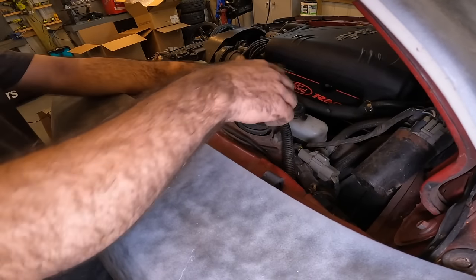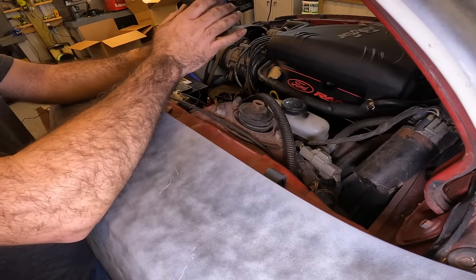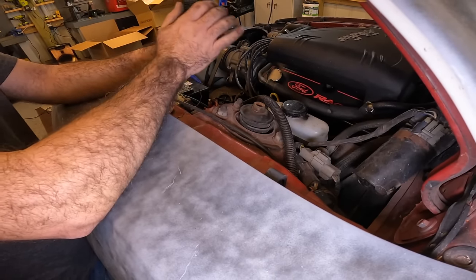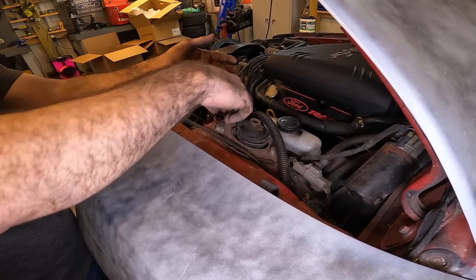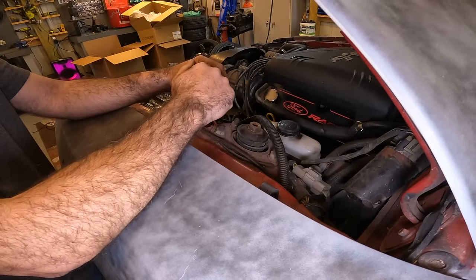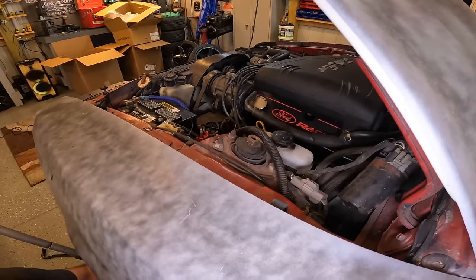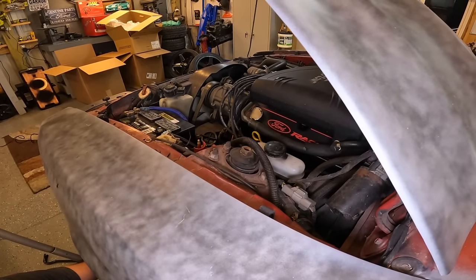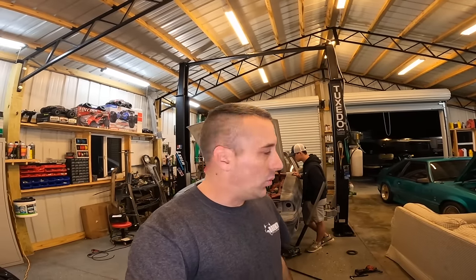Go ahead and address the elephant in the room: this car needs caster/camber plates now. If you lower your car, you're going to need caster/camber plates — just know that ahead of time. You can slot these out, but it's best to just go ahead and buy the plates. Andrew, do you have caster/camber plates on your car? No. Should you? Yes. Has it ruined a set of tires on the front? Yes. I'm simply going to go ahead and bolt everything back up in the reverse procedure. I'll meet you guys in the back of the car whenever we do the rear coils.